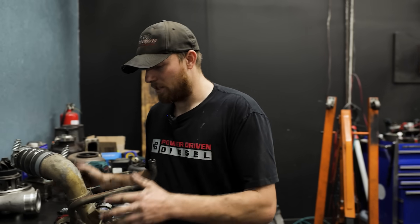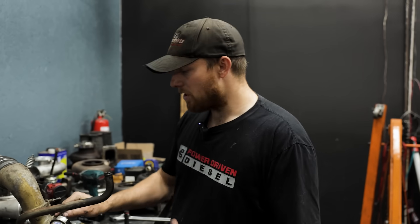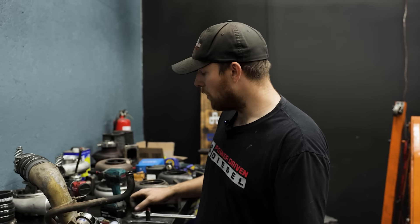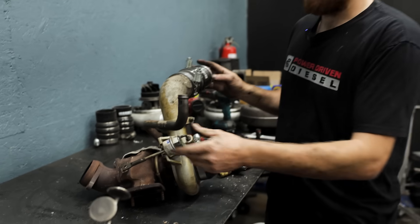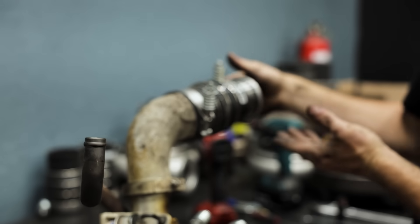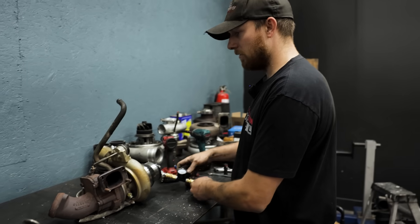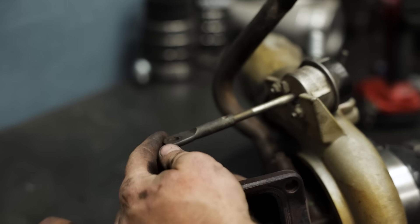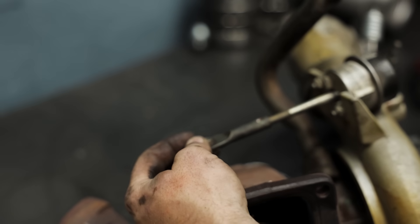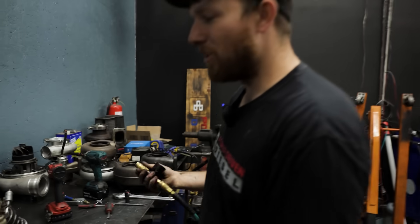Let me explain what we got going on here, because these things were really never meant to do what we're doing. If this was like an HX35 or some other turbo where it has a hose, I would put a little compressed air into the hose and that extends the rod, you hook up the rod, and you're good to go. This thing doesn't give you that same luxury, so we've got a PDD boost leak checker with a random assortment to plug off this end so we can pressurize the whole cartridge and extend the rod. Dude, love it when a plan comes together — that worked really well. Boom, now we just have to slap the whole thing back on.